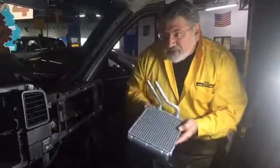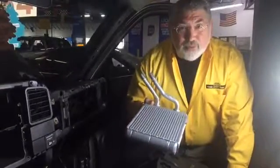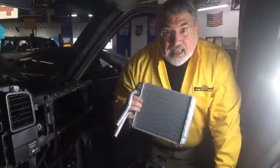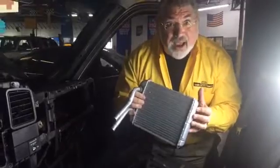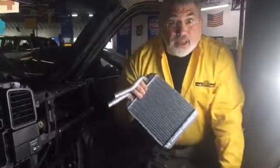Now, the manufacturers have been really nice on one side, where they give you the long life coolant that everybody says goes for 100,000 miles. The problem is it becomes very acidic, and that high acid eats this soft metal. This is all aluminum, where they used to be made out of brass. It was a much sturdier product. Today it's all aluminum, and they go bad really quickly.